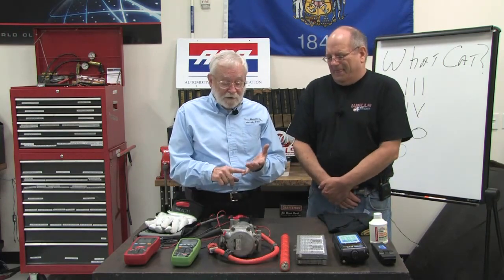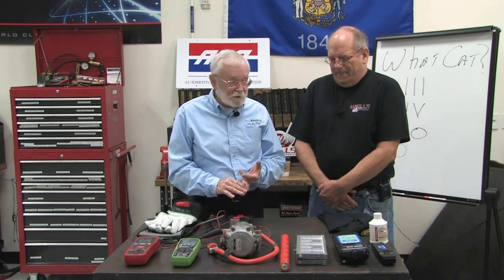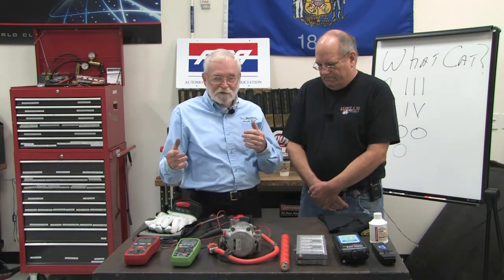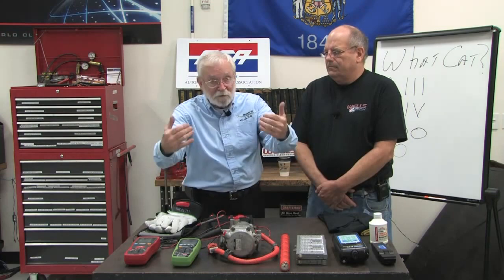Now, is that the case? Do you need a 12-volt battery? Do you have battery cable issues where the battery could not be charged? Or is there a problem charging the 12-volt battery with something called the DC to DC converter? There's no alternator on the hybrid. We use a DC to DC converter, which takes the high voltage battery's output and steps it down to the level that we need to run the car's electrical system and charge the battery, around 14 volts or so.